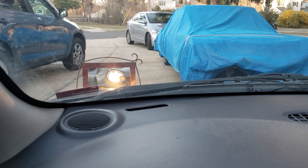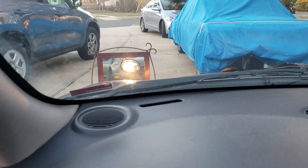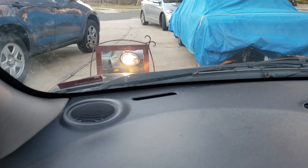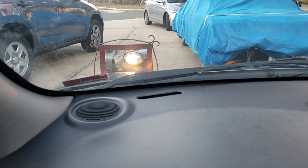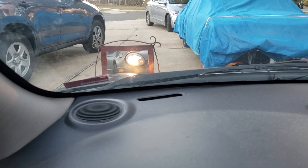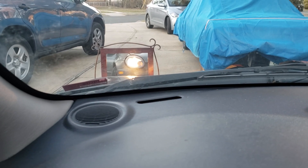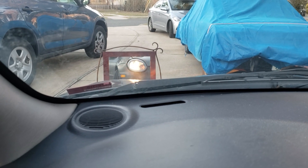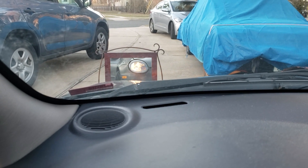The headlights are on — you can have an assistant stand by. I put a mirror over there for now. When you turn the key, if the lights dim, then it's a weak or a dead battery, or a bad connection.